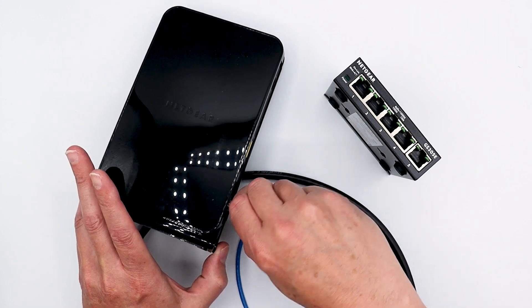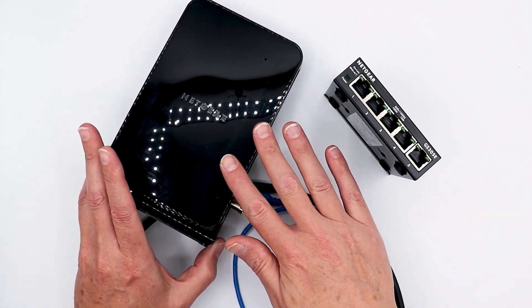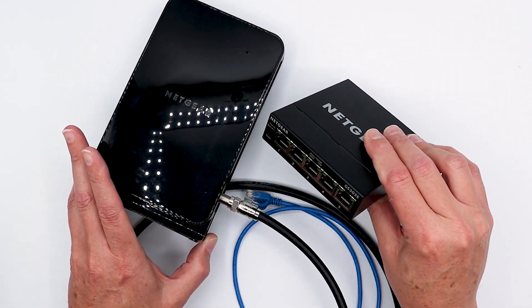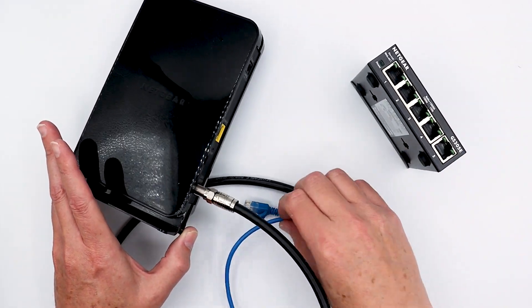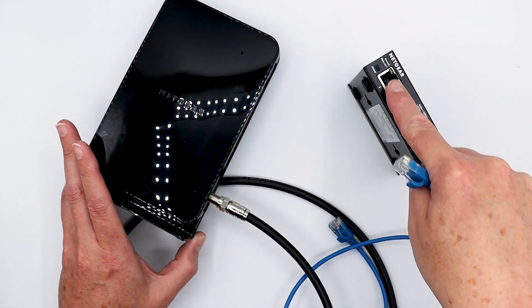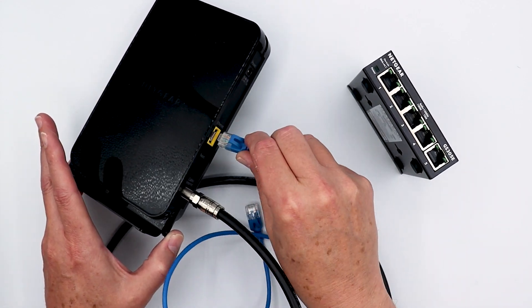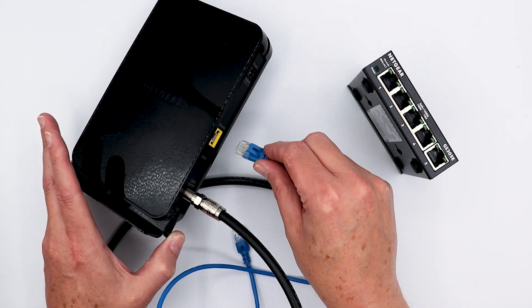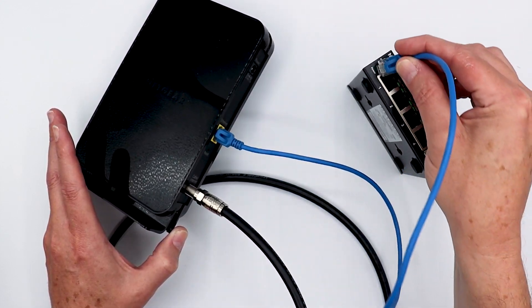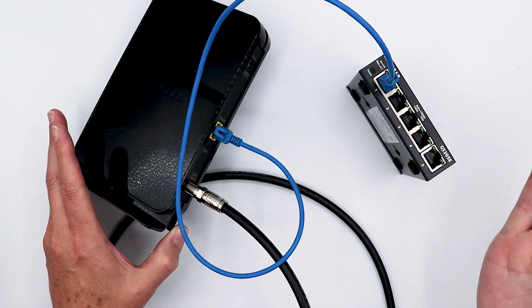So you've got your coaxial cable screwed into the back of this cable modem, and let's assume there's a four-port switch here. The cable modem is in fact doing the routing, so this external device is just a dumb Ethernet switch — it doesn't do any routing at all. It's just used as a way to extend your network, which is exactly what we're going to do. In that case it's actually even simpler, because the routing and everything else is being done in the all-in-one, so you don't need to worry about which ports you use. You just pick any one of the four switch ports on the back of the all-in-one device, plug in an Ethernet cable, and then pick any port you like on this switch and plug it right in.